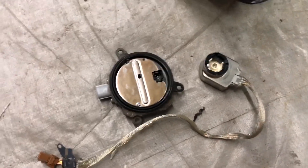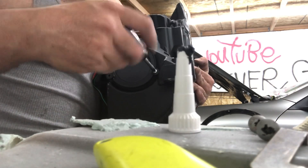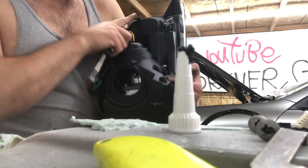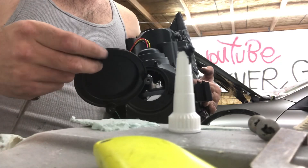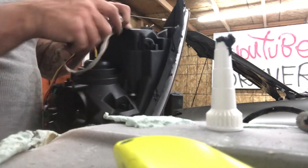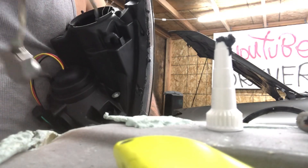The reason I have to take apart the OEM lights and put the ballast and everything in is because the Spec D's don't come with ballast or anything. So you have to run the wire through here and back out through the top, then connect that piece you took off down here — where you took this off — because this just replaces the ballast. Basically you're going to run this wire through the top of it, down, and make it pop out the bottom right here, because this bottom piece connects back to the ballast. This goes through the top low beam. So we're going to drop the cord down in there — it's not an easy job, but we can get it done.